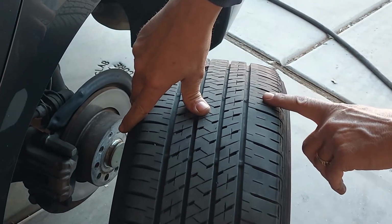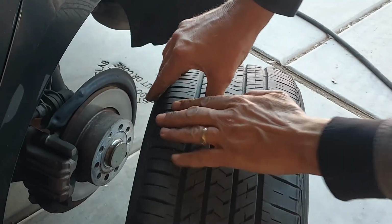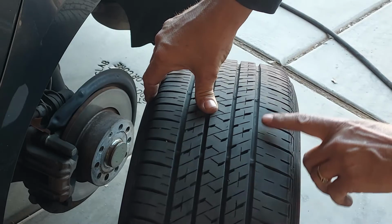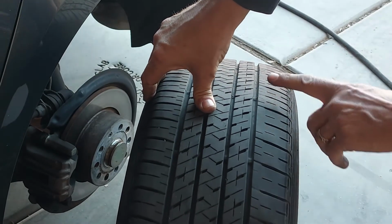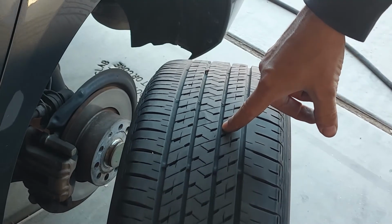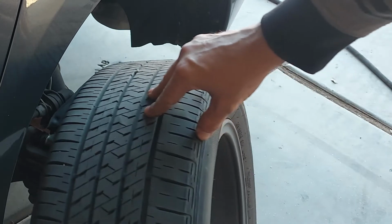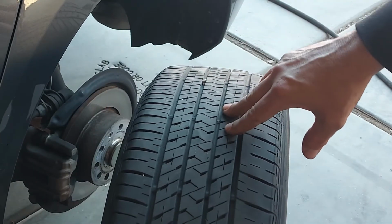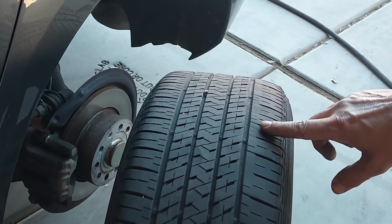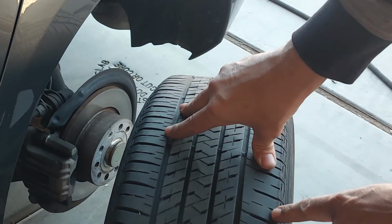And every other tread is flared up on the inside. I don't feel it on the outside, okay? These are original tires. These have 62,000 miles on them, okay? They're starting to get a little cracked, weathered, but seeing how these are flared up, that's a good sign of a bouncing tire.